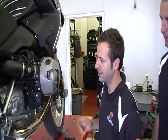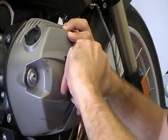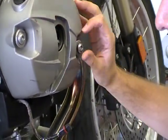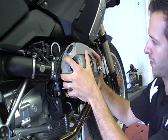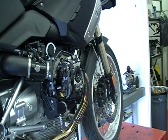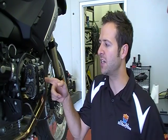It looks like you've got it prepped up here. I'll remove the ignition coil, and I've loosened these — obviously these are T40 Torx bolts. There's a lot of buzz out there that the new motor is something you can't work on. The valve adjustment interval: they still recommend that you inspect them every 6,000 miles. However, with this particular setup — the new valve train and the material they're using for the valve seats — they probably won't need to be adjusted nearly as frequently. The price for inspection isn't as much as for the adjustment, so you're not going to actually adjust them until much further along.